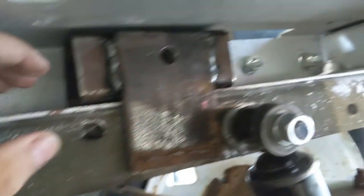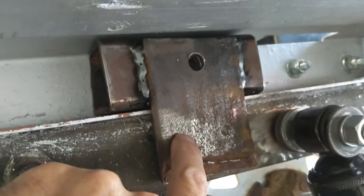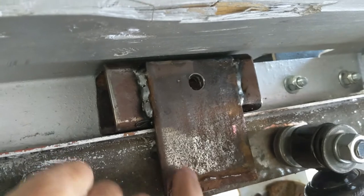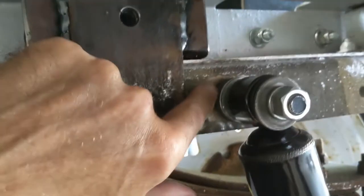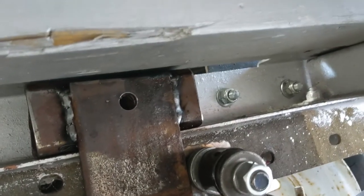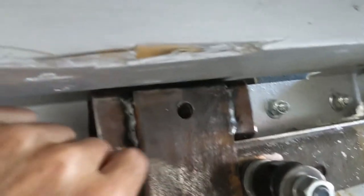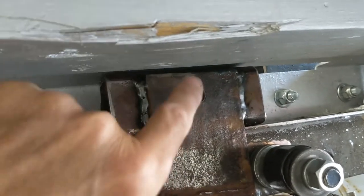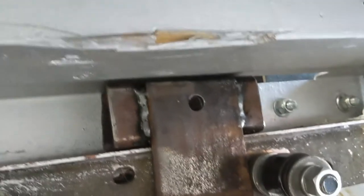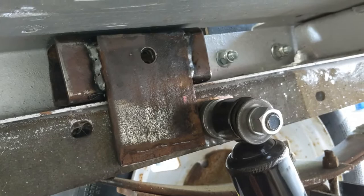This is what I'm looking at — still a little hot from welding so I'll touch it gently. I'm going to put a hole here and a hole there, drill them right through once I get them placed. The half-inch stud for the shock goes here, and once I get rid of the old stud I'll slide it over — that looks like a good spot, maybe a little more forward. I already have two of those pieces made. I'll drill a couple holes, weld the studs in, cut the old stud off, paint them up, then install them.